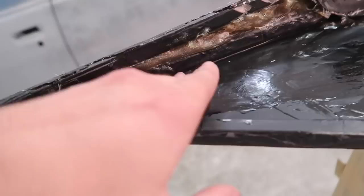The fiberglass is just not dry enough that I'm going to be able to start sanding it down and then putting some bondo on top of it. This piece I did trim that a little bit, and then I'm going to take the DA right there and trim a little bit of this down — bring it down until it's flat, and then we're going to be able to start applying some of that bondo.